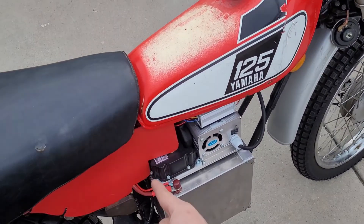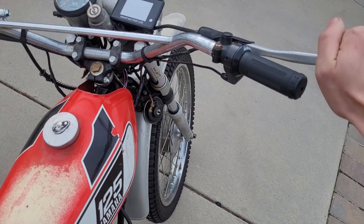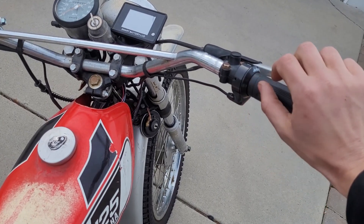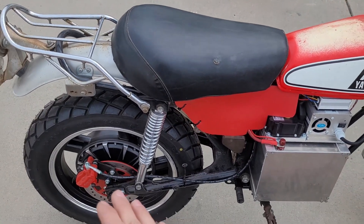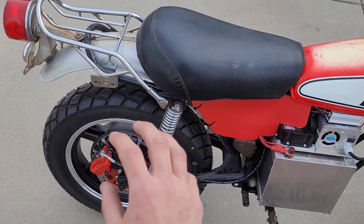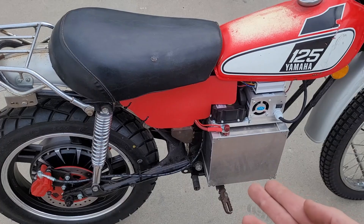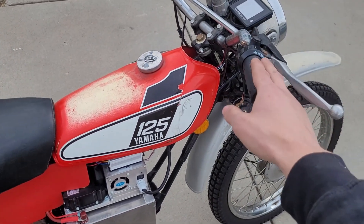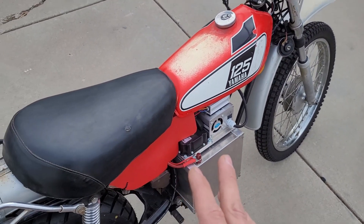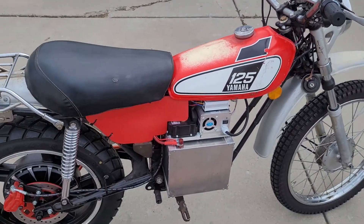The controller is pretty cool. It has parameters where when I'm hitting the gas, it sends full power to the rear hub. And then as I let go of the gas, it goes to full regen mode — there's braking within the hub motor that sends current back in and recharges the battery. That can all be adjusted. You can adjust the current value for feel. With full regen on this, you almost don't even need to use the brakes at all, which makes it a super efficient machine.